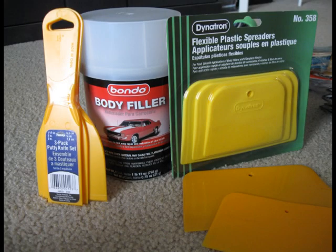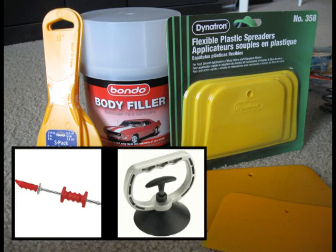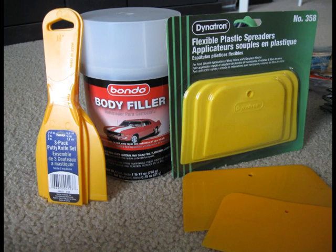In order to cover up the hole, I am going to use Bondo body filler. It comes with a little tube of red hardener that will have to be mixed with Bondo before applying it to the repair area. Before applying Bondo body filler, try to reduce the dent to the minimum with dent pullers or suction cups so you can apply as little of the body filler as you can to make the area look good.